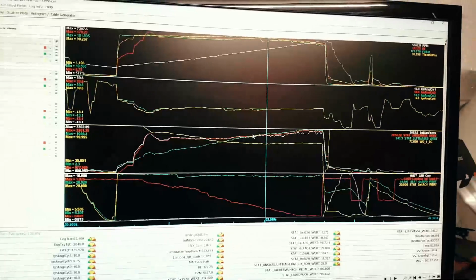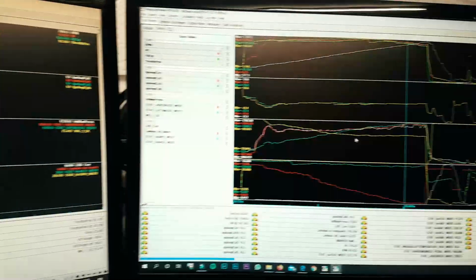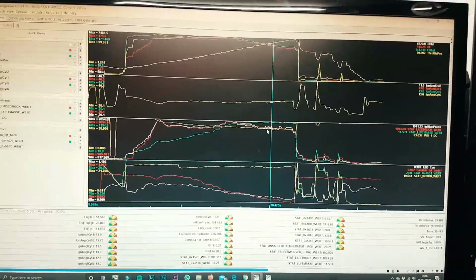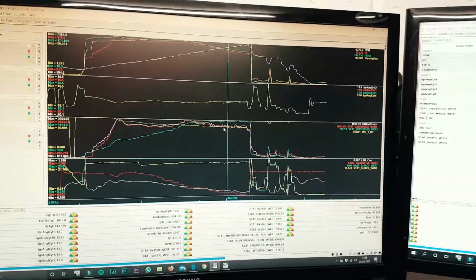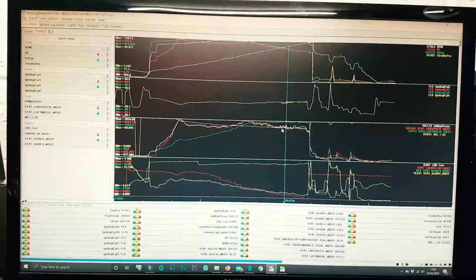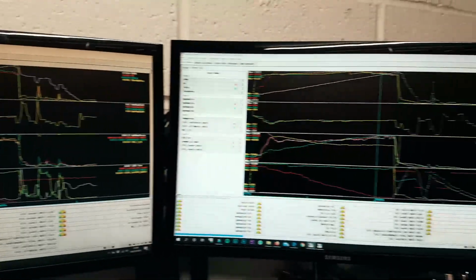Whereas on the M3 and M4, fill target stays up and boost climbs right to the top, so it allows for about 1.2 bar of boost, whereas on the red line on the M2 Competition, it literally is less than 0.95 bar of boost. And that's purely down to probably the manufacturer knowing the limitations and not making a car more powerful than the M3, M4 at the time of release, and also down to the GPF and drivability and emissions, etc. So, hope I didn't bore anyone with that, but it's a good insight as to why they differ in power.